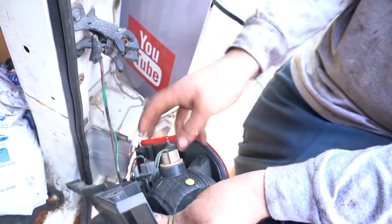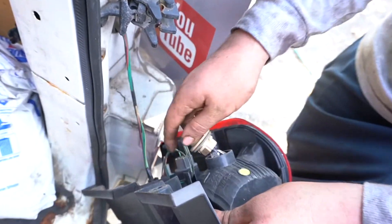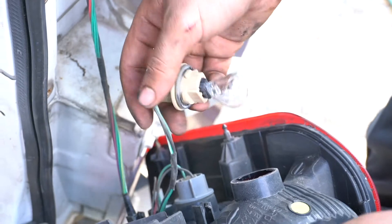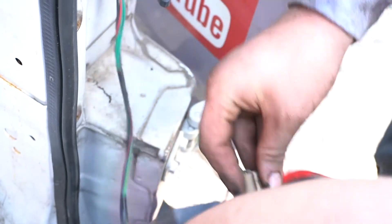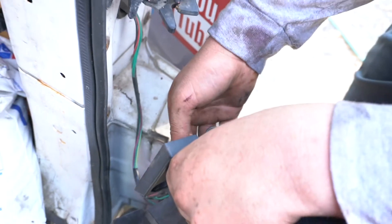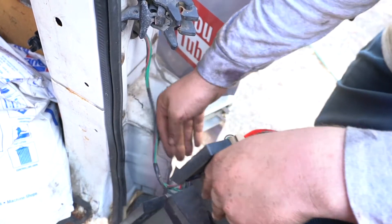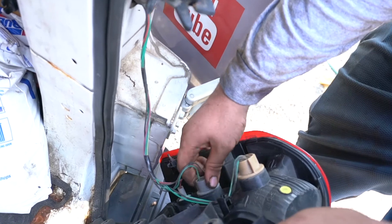Then any one of these lights that need to change, give it a twist to the left. Pop the harness out of that little clip, then just take it, yank it out, clip the new one in — and rinse and repeat. Be sure to clip the harness back in. This is the only one that has one of these clips, but either of these, just turn left.